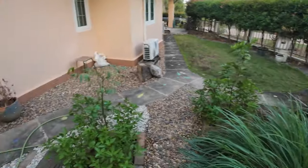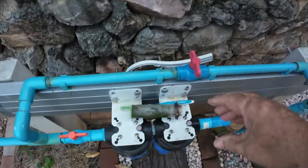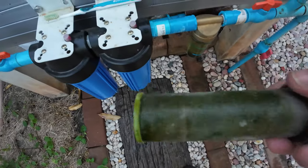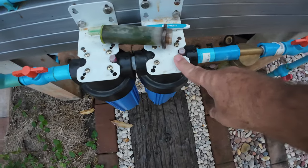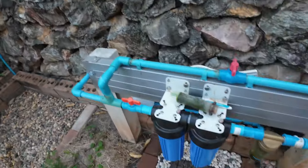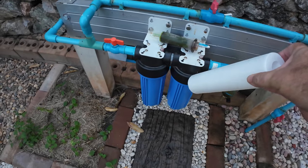You can't hear water coming in, so I cleaned out the spin filter, but it's still grubby. I checked whether the next filter was blocked and there's still no water going in, so I'm going to change that filter now.